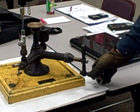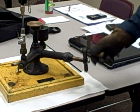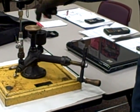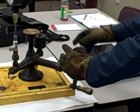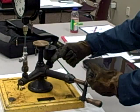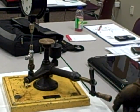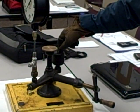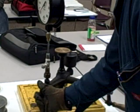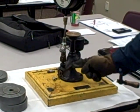What I'm going to do first is take this secondary piston and back it out. When I back it out, I'm leaving this valve open. That valve goes to the oil reservoir, so as I back the secondary piston out, it's pulling oil from the reservoir and filling up that piston chamber. So I back it out a few turns like this. Now I close this valve. Then I make sure this other valve is open, so now the gauge is able to see the pressure in here.